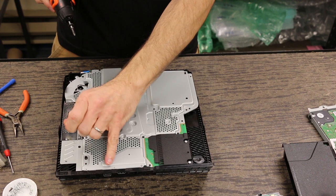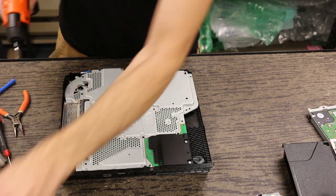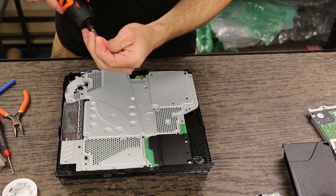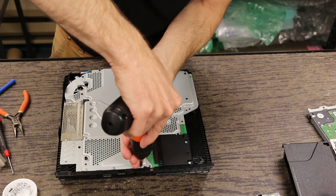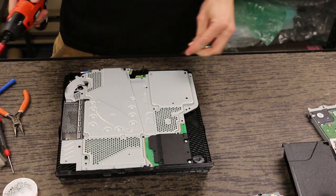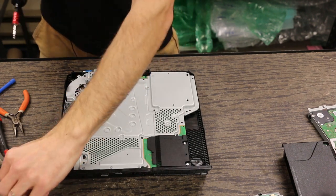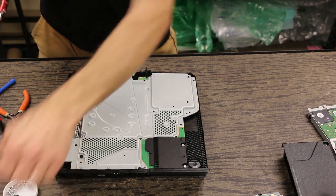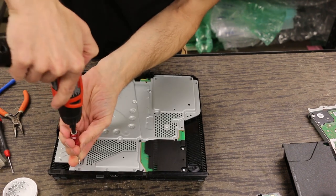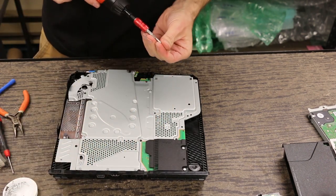Then we've got three silver screws that go here, here, and in the back. After you get all your other screws in, you know that the only screws left and the only thing that goes in the remaining holes are the T8 security screws. So you can just go quickly and fill in all the spaces. It's good to double check to make sure you didn't put one in the wrong place, but the rest of the spaces are going to be the T8.